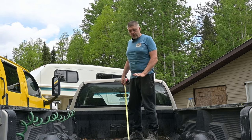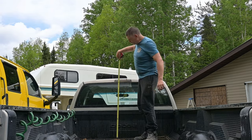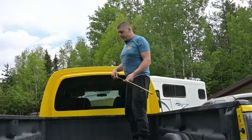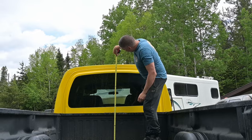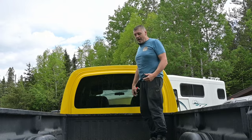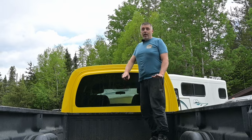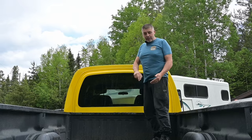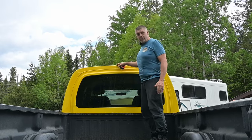This truck sat — in this Dodge truck — the camper sat right on the bed. Our cab height is about 41 inches, pretty close to the tailgate height. So this truck has a really high cab. We're probably 53 inches on the cab height on that one, so considerably higher, which means we're gonna have to raise the bottom of the camper up. Not only do we have to lift the camper higher to get it up to the tailgate height of this truck, but then we gotta lift it another bunch more to be able to clear the cab with the proper amount of clearance.